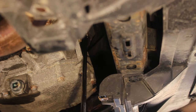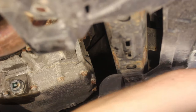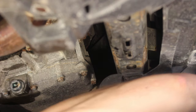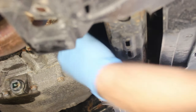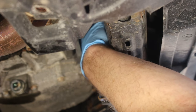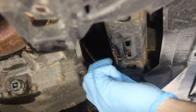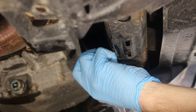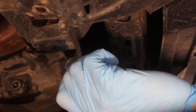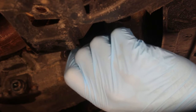I'll reach up there with a wrench or a socket and loosen that. Now you've got your drain pan under there. Take this off before you drain the fluid — there might be some fluid that comes out. Looks like the washer stayed stuck to the transmission, so I'm going to use a screwdriver to pop that free. Once we've filled it and checked the fluid we will replace this ring, but don't replace it quite yet.